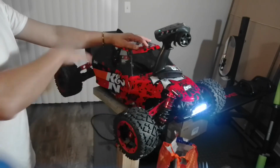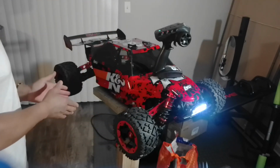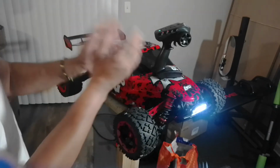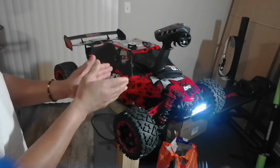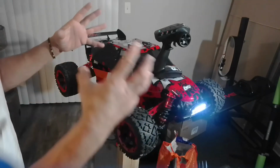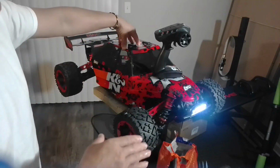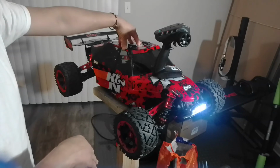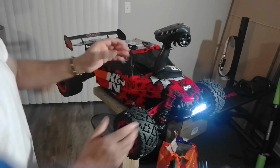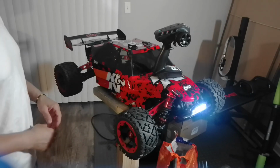So what I was saying, guys, I was just talking about the specs, the motor versus the ESC. I researched the specs of the ZTW 620 kV motor, and I already know the specs of the HobbyWing EZ-Run Maxx 5 because I have like 3 or 4 of those. So when I researched both specs, I know that they can work, you understand? Just that, given that I run an 8S, or lower. I can run 6S or 4S, no problem. But the highest it can go with this setup is 8S. So guys, you see, it works, right?